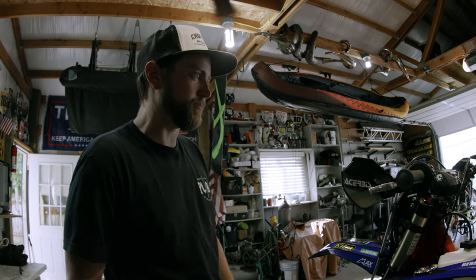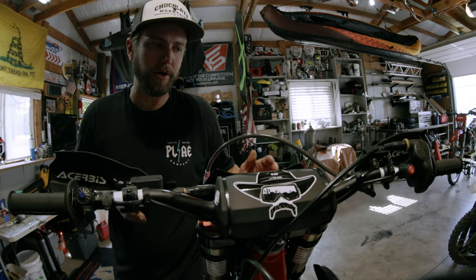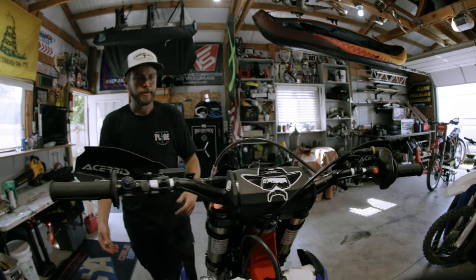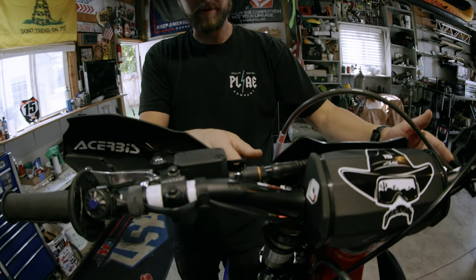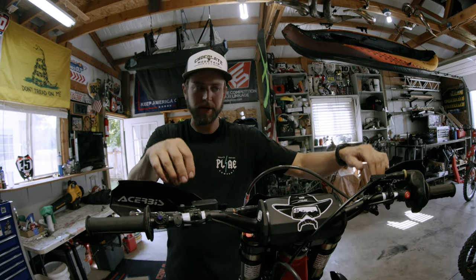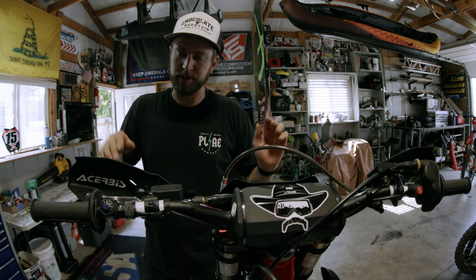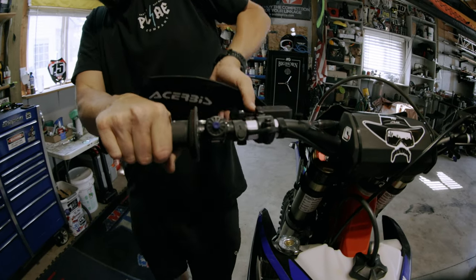All the wire routing has been kept real tight — cables up to the starter and kill button are tucked in behind the handlebars. Max is going to be taking some heavy roost off the starts of these Enduro Cross races and down some of the straightaways, and we don't want that to hit one of his cables and give him a problem. I'm even thinking about what kind of zip ties I'm using on these handguards — these are like 150-pound rated zip ties. I also put Teflon tape underneath the perches so it prevents those things from breaking. You can get them real tight where you're OJing flat landings and they're still not going to go down, but when you crash you can still get them to move and then move them back.